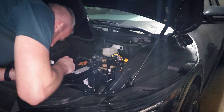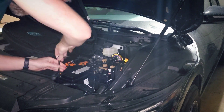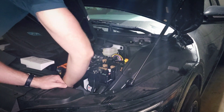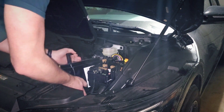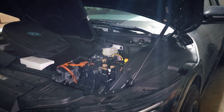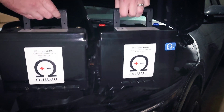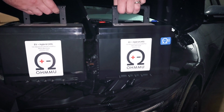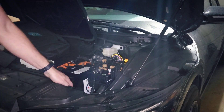Here's a quick overview: you open the fuse box under the hood and pull up on the tab for the high voltage battery disconnect. Then you open the frunk and remove the piece on the right side. Then you disconnect the battery terminals, take out the brace on the bottom front of the battery, and remove the old battery. I'll go ahead and install the new one in place of the old one in the reverse order of what I just did.